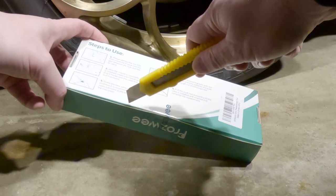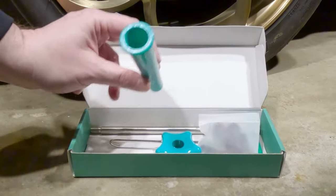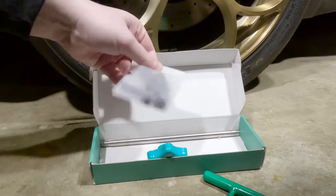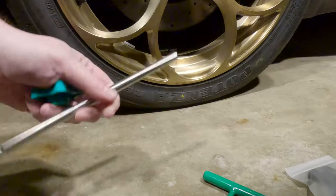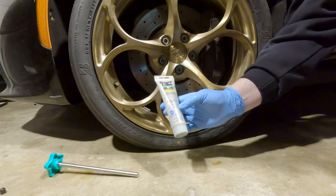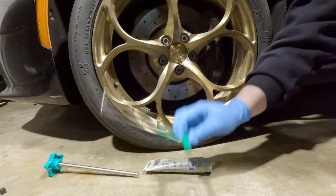Let's get this thing open and see what's inside. The thing that really makes this kit work is going to be this little forcing cone — I'm going to show you how that works in a minute. We have this little hook handle thingy, some extra valve stems which we need, and here is the installation rod. This little twisty handle just screws right on and into the rod there. Now what it doesn't come with is some lube. I really like this super lube stuff — it's a multi-purpose silicone grease, it's kind of amazing. I'll put a link for this in the description below, and I'll have a link for this kit in the description below too so you can get it if you need it.